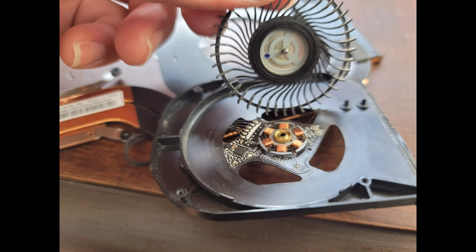To remove this fan propeller, it's very difficult. You have to get something small to fit through all four little holes in the back of the fan so that you can apply even pressure to the propeller blades, and then you can push down on the fan assembly and it'll push the propeller blades up and out. I believe I have a video of this process on my YouTube channel, so if you want to see that, just leave a comment below and I will try and find that and send it over to you.